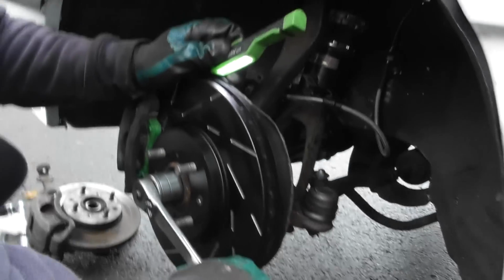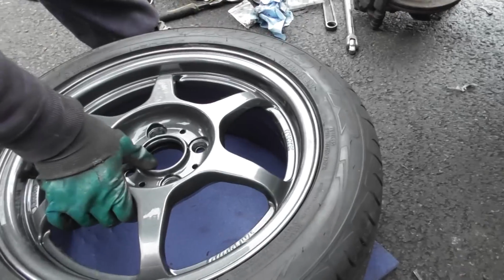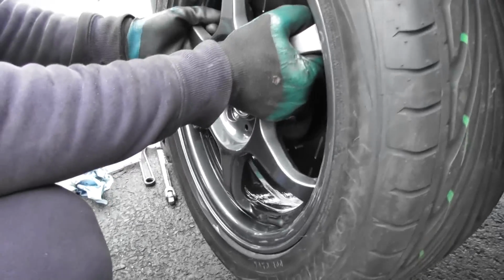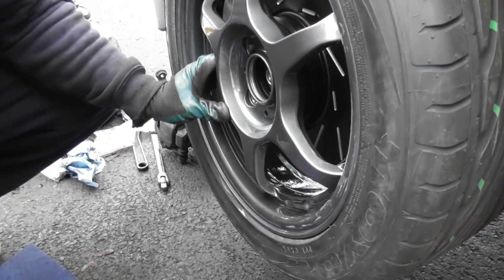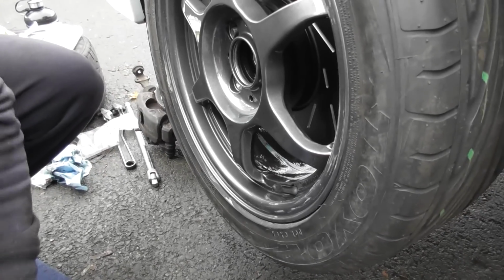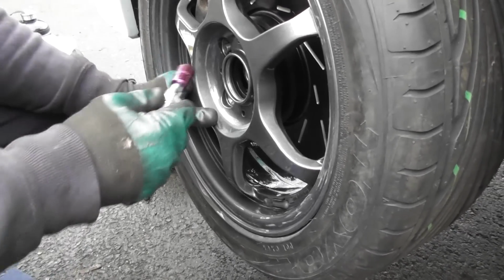That's all that done up. I did do it in the end. And then get this 32 mil, just snug it up, and get your wheel. Obviously centre cap removed, because when you drop it on the deck you can actually get a breaker bar on the 32 mil. And there. This is the first time we've ever had the 282s on there with these nuts.